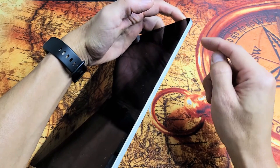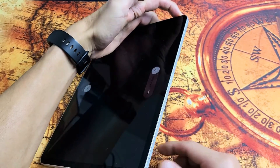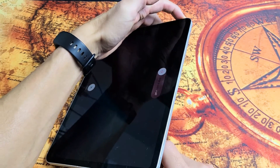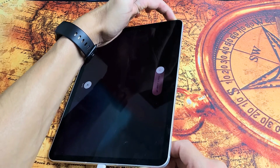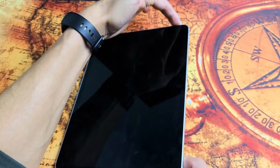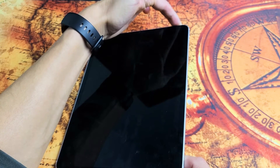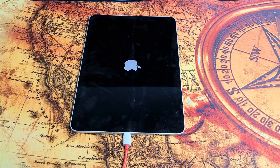Let's do it together. Volume up, volume down, and then press and hold that power button and do not let go. Pretend my screen here is black — I'm just holding on to that power button, waiting for an Apple logo to appear while it is plugged in and charging. There it is — go ahead and let go and let it boot up normally, and hopefully you are out of the black screen. If not, we're going to go to the next possible solution.